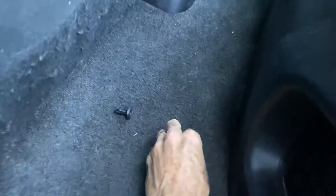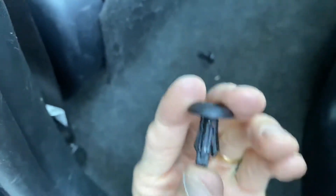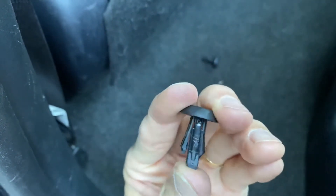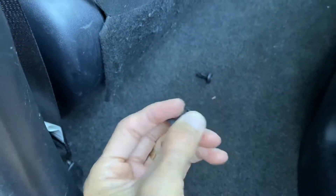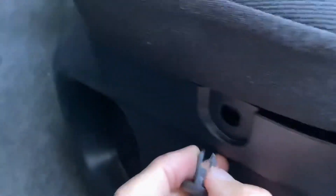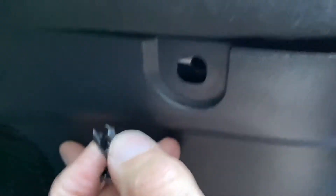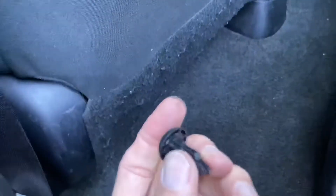Reset the fasteners, which you can do by squeezing the button back out and pulling it all the way out so it looks about like that. That allows these to squeeze in place. If you pull the panel in place, you can see the hole in this area here, and you can insert the panel fastener back in place, then push the button flush. Same with this fastener.